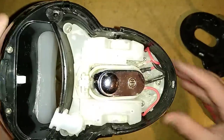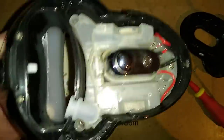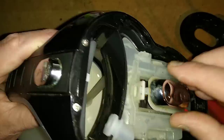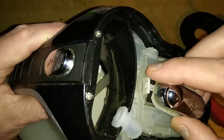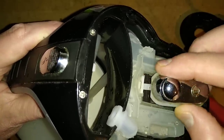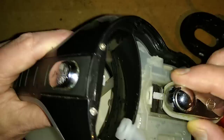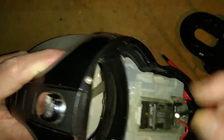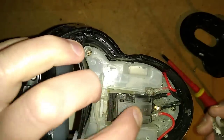Here is the switch mechanism. It's got a lovely chrome top which just physically unclips. Note that this little stem here hooks under that little plate - the point of that is a little steam vent that lifts up and down. You can lift it out and take a look - it's a little steam port that allows the steam to vent out of the unit to allow a faster reset.